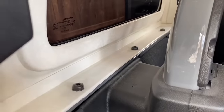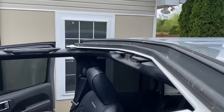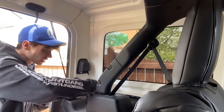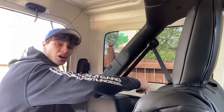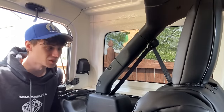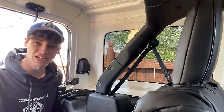Now looking from the backside, you'll see that you've got three bolts on each side — three right here and three on that side as well. And then aside from those, all you're going to have is your top ones, one on each side. That's literally all you'll have to untighten to get this top off. You can use power tools to get these off — I think that's perfectly fine. But I don't recommend tightening everything back down with power tools because if you over-tighten them, you could crack that top. It's just not worth it. Almost inevitably, if you do it enough, you're going to end up messing something up. So I just revert back to the old hand tools — it's simple and just takes an extra few seconds.